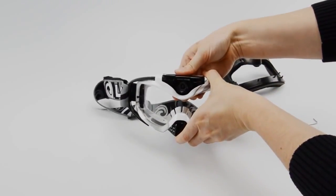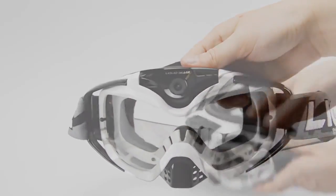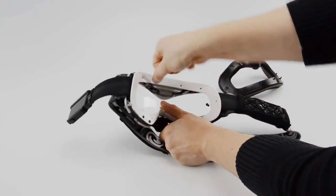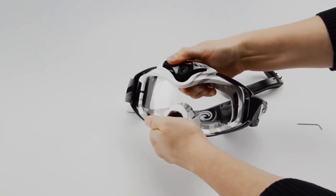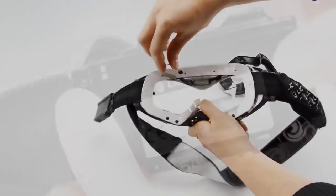One of the features that differentiates this model from last year's is the tilt lens. To access the locking mechanism of this feature, remove the face foam from the back of the goggle. Take the hex allen wrench and insert it into the hole on the back side of the frame and turn one full turn counterclockwise. You should now be able to adjust the camera from 0 to 30 degrees. To lock the camera back into place, turn the hex wrench clockwise one full turn.